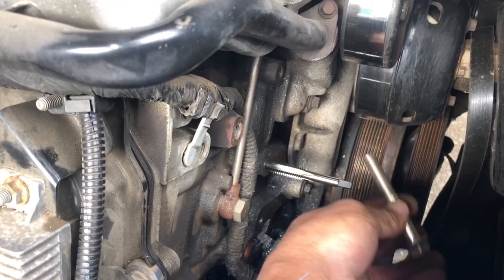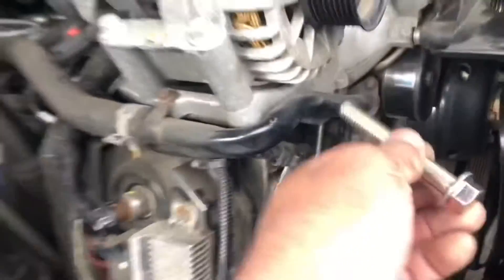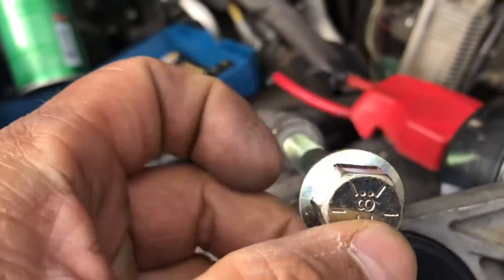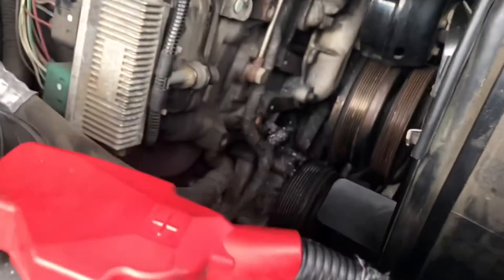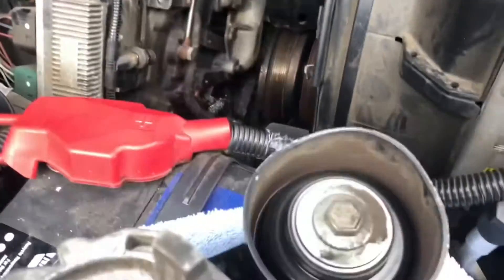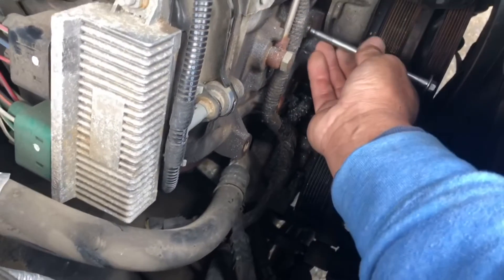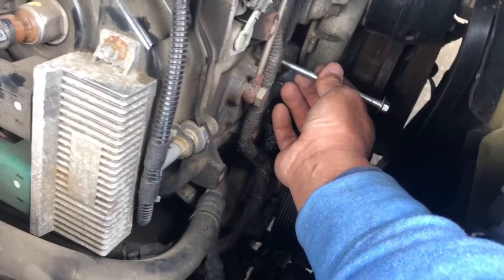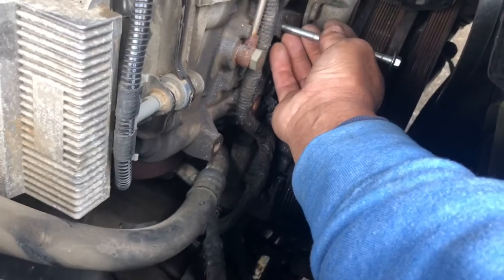Tap that out. We're going to upgrade it to this bolt. So the bottom bolt is clean now. The new one goes in just fine — threads are looking really good. We were going to go with the helicoil, but I just feel like the threads in there and that boss are going to be stronger with the new bolt, so we're going to upgrade it.